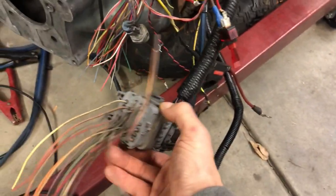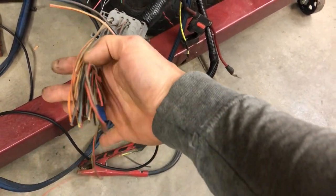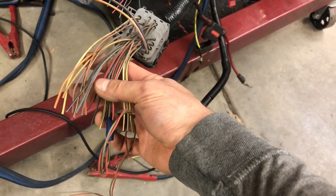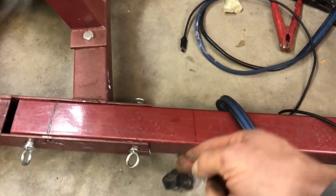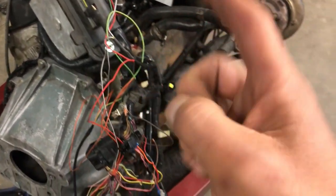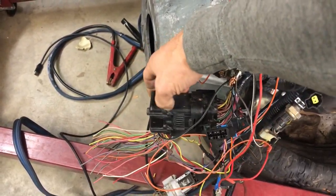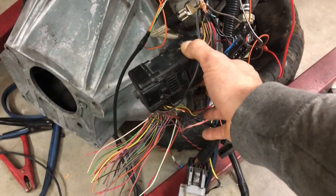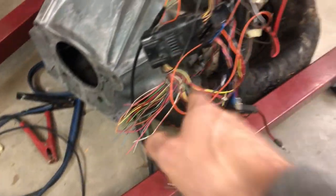You also have this smaller gray plug — I think it's a 32-pin. On my truck I have a manual, so I basically cut this plug off and just wired in the features I needed, which include the primary O2, post-cat O2s, reverse lights, and speedometer. Some of the later Rangers actually don't use the vehicle speed sensor in the transmission — they have one on the axle, and the signal is sent to the ECU from there via the ABS module or the GEM, depending on year and configuration. This plug does plug into the Ranger on a lot of years — most Fords have this 42-pin plug — but you're going to have to change a few things. For example, the wiring for the alternator runs through here, and if it doesn't have a gauge, the alternator won't charge. I'll go over that in more detail in the next video.